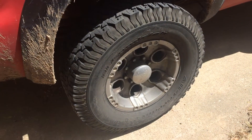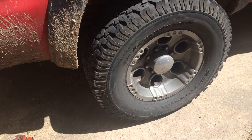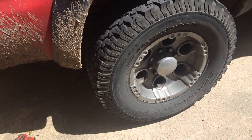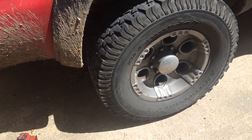Today we're going to be working on the rear brakes - changing out, or at least seeing if I can have my rotor turned if there's anything left of it. Associated with that we'll be changing out the brake pads, and I might change out the caliper too just because it indicated some issues.